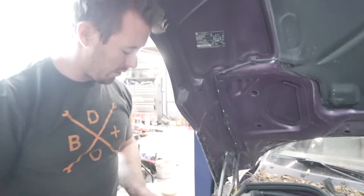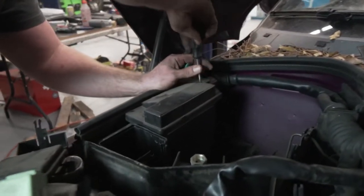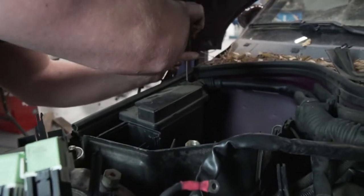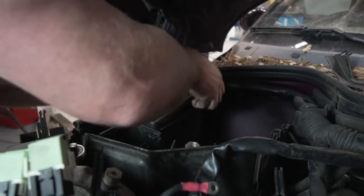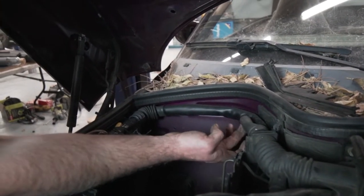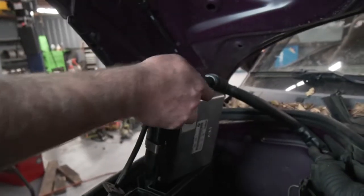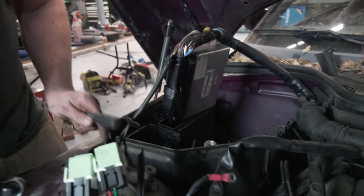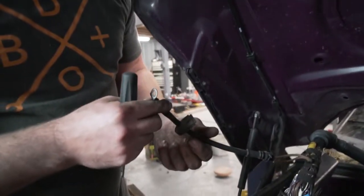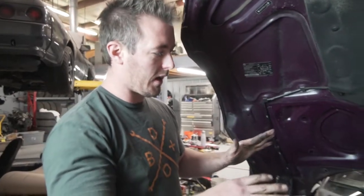Next thing you want to do is your ECU. You've got three screws on the top. Once you get these off, this is going to give you access to the DME/ECU compartment, where we are going to disconnect the engine harness from the computer. If it is an auto, you're going to see another loom of wires coming out of this little connector, going into there, and you're going to want to disconnect that one as well. But since ours is a manual, we're just going to disconnect this little fella. This ground needs to be off this plug — it goes with your harness as well. This is your DME ground, so make sure you get this off. That concludes your top side, passenger side wiring. Now we're going to move on to the driver's side.